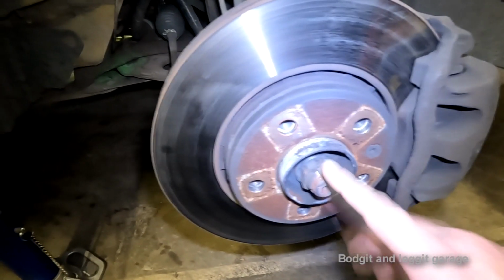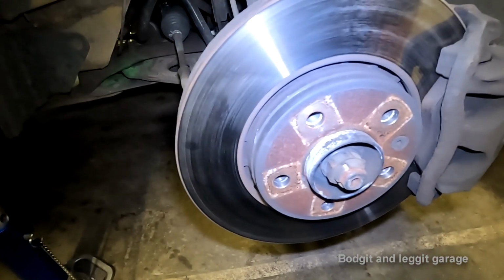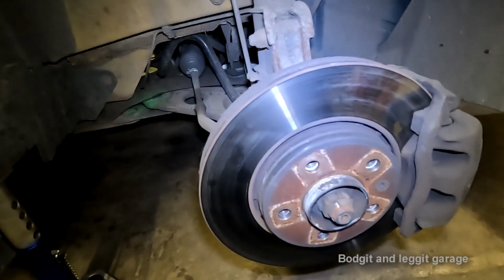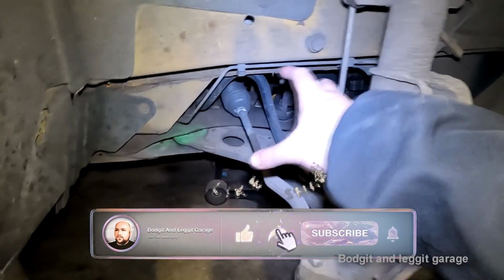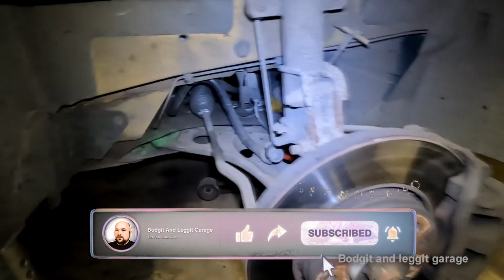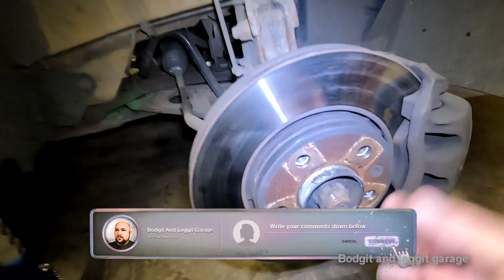I have found it easier in the past when you're doing anything with wishbones, even on a lift, to also loosen your drive shaft, because that allows you to move the disc and the suspension out of the way without pulling your drive shaft out of your spline. In other words, you've got a little spider in there with bearings and it goes into a little coupling, and if the little bearing falls down, it's just a mess. You don't want to be dealing with it. So undo this and then you've got a lot more movement. It's a hell of a lot easier for you.